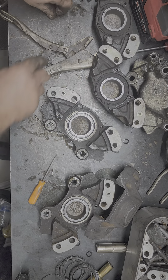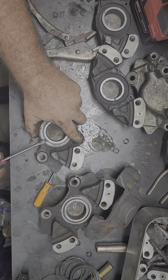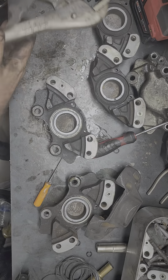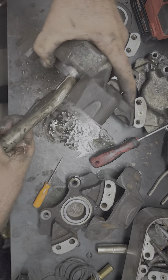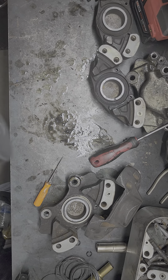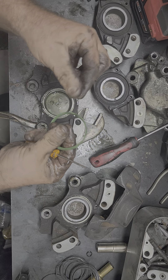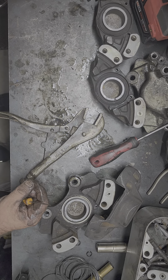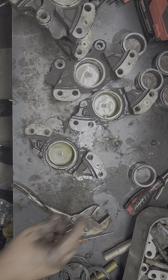So I'll go ahead and get the — I'd like to clean everything up. I'm going to take the screwdriver, raise this up just to get that piston up out of there, like that — take our vise grips. We're going to be putting new pistons in anyway. I actually have to put it back in a vise. There's your piston, there's your seal, just like that — drill that out. And we're going to go ahead and continue getting the rest of these out. And there you have it, pistons all yanked out — we got them all taken out of there.